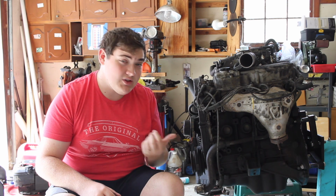For this video, we are going to start the teardown of the engine. This will be basically all the accessories. We'll probably do exhaust, valve covers, intake, stuff like that. When we actually take the head off, you have to take it off in reverse of the torque spec. The reason I'm doing this, like I said in the last video, is so I learn how to do it properly, so we're going to try to do it as proper as possible. I'm going to save the actual disassembling of the core of the engine for the next video. This video will be all the basic stuff, as well as getting it on the engine stand.